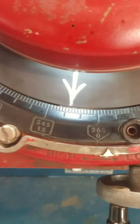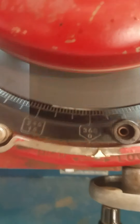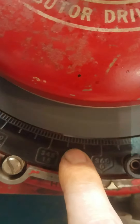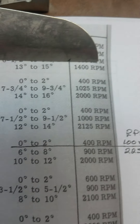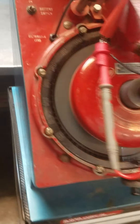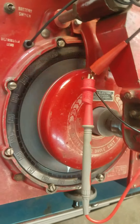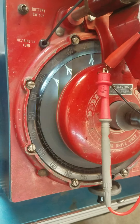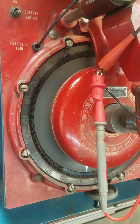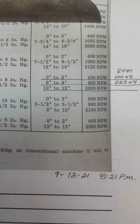225 times four is 900 RPM. Dwell's off a little bit. Let's see how much advance we got — here's zero, here's five, about eight degrees. The spec calls for 6 to 8 degrees at 900 RPM, so we're doing good. We got a pretty steady flash. I'll put the 12 flash on again — we're doing pretty good there. Turning 12 flash off and stopping to go to the next step.